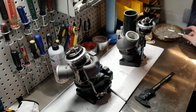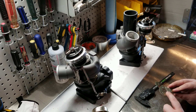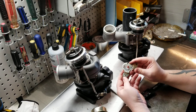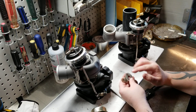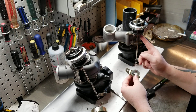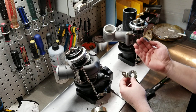What I did to start was I basically took the factory wastegates — I can put these back together if needed — and I drilled out the little teeny welds and popped them off. For this turbo it was real simple. All I did is I went to a piece of 1/8 inch stainless steel, put it down on top, traced it out, traced the holes where it needed to go onto the turbo.